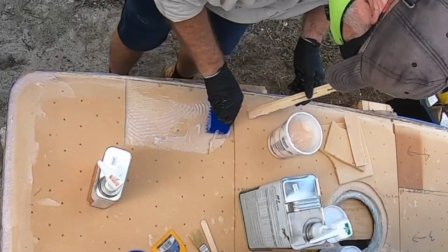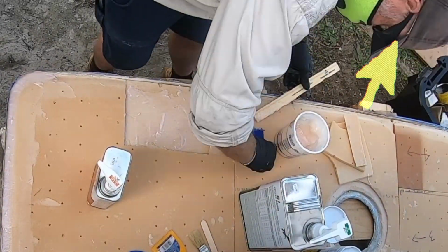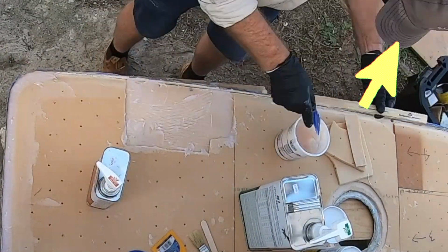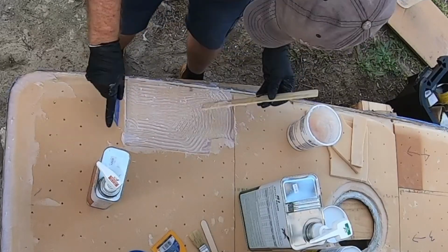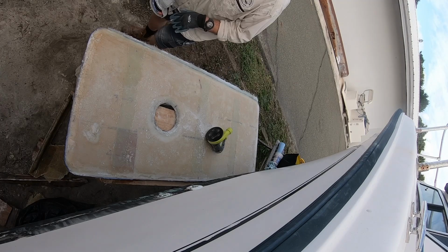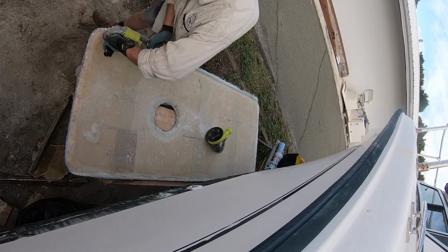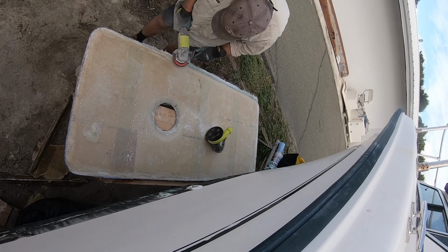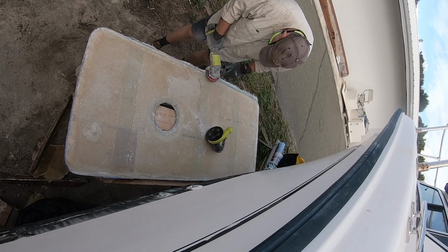While I have a bit of experience with polyester resin, see my centre console conversion project here, this was the first time I'd used epoxy and I had 2 problems. Firstly, it kicked off much faster than expected, and secondly, I was limited in my tools. I didn't have a fin roller, for example, so ended up with a few air pockets. I'd grind these out later, but firstly it was trim the edges and wash the next layer of amine blush off.